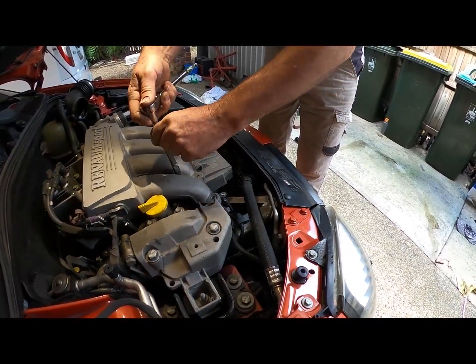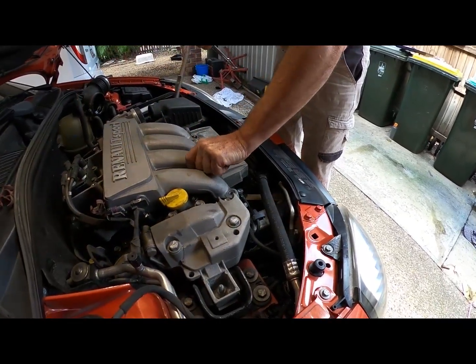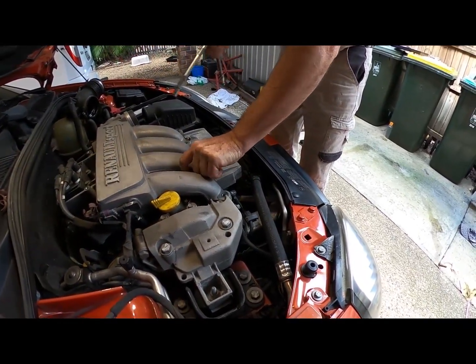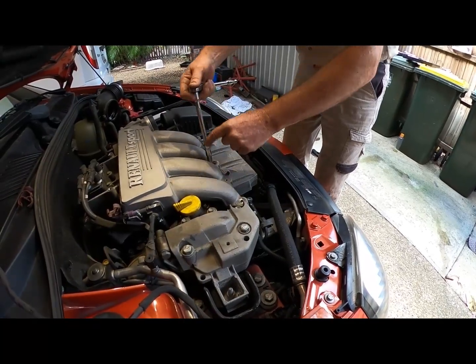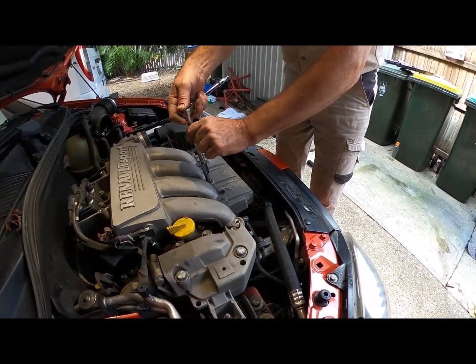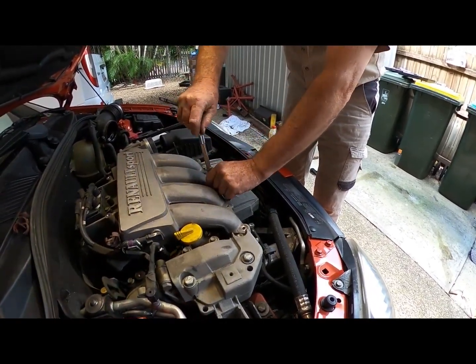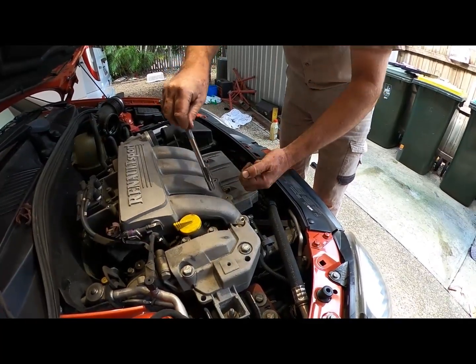Now this is part of the reason why guys often end up changing the intake when they're doing the turbo conversion, because you've got this coil pack sitting where you'd want to put on above your exhaust. Yeah. At least this way we can show you what a 182 Cup exhaust system looks like. You'll be able to see the extractors. I can compare them to the 172.